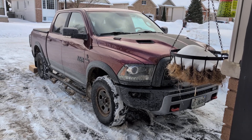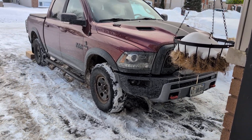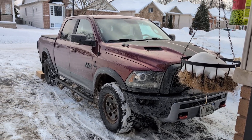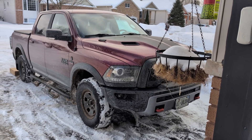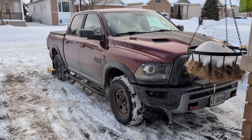Mine was so bad it was giving me a service electronic brake warning because the front had leaked out through the back and it was slammed and everything was all messed up. As soon as the compressor kicked on, up it went — wasn't even doing that before. Super easy. And if you can get an aftermarket part that works just as well, then why not?